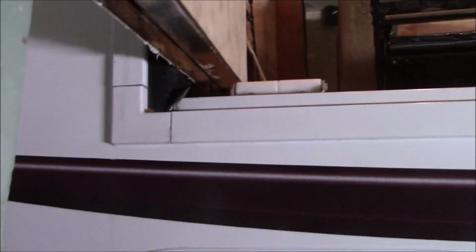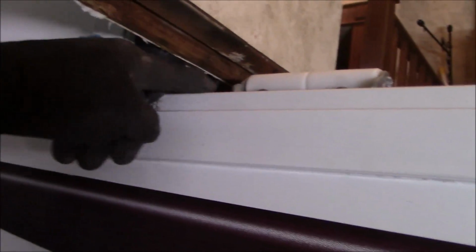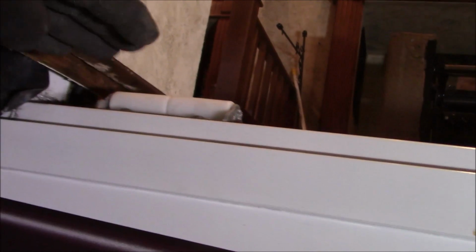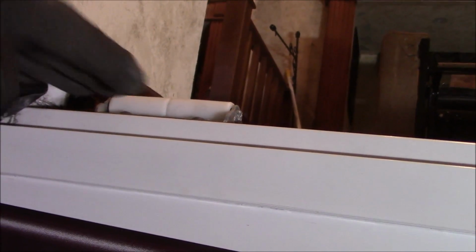I mean, it's just piss poor engineering. That's all it is. They should have had this recessed. If they had this recessed from the factory, just molded in there on a ramp, it would have come right out. But there's not even really a bottom sweep gasket on these either. So all that weather is just coming in and it's going to roll right back onto the plastic piece that they have up underneath here, that underbelly. It'll just keep rolling back in and start rotting out the floor. So that's what we're working on.